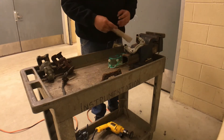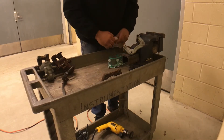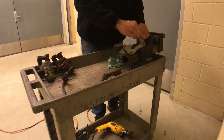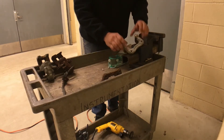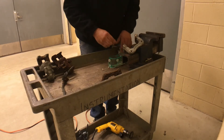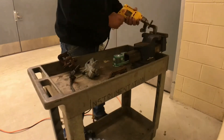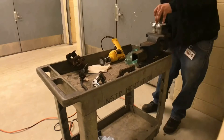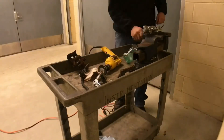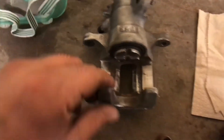I'm going to sand these down and get them ready for painting. Before I start painting, I'm going to take a paper towel and fill the holes for the slide pins and also where the brake line went on the caliper so no debris gets inside. I'm going to use a Dremel tool and a drill with a wire brush on it to clean off any surface rust. Now they're pretty much cleaned up — just have to do a few spots by hand, then tape them off and they'll be ready for paint.